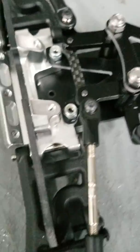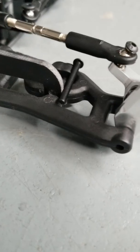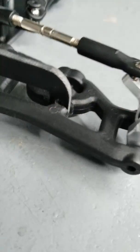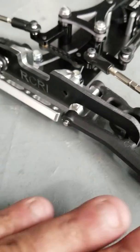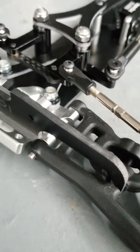This is also adjustable. You have two mount holes on this arm — you can see them right there on the top — and that's your ride height adjustment. With the bottom hole you'll be totally level and flat, and with the next hole it drops your car down a little bit more. It depends on the type of wheels you put on the front as to which hole you use.